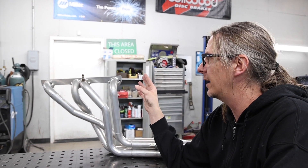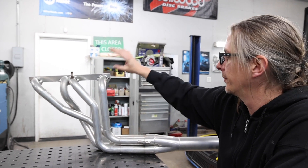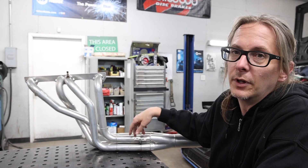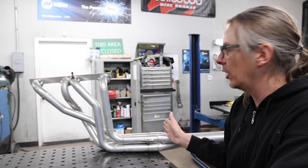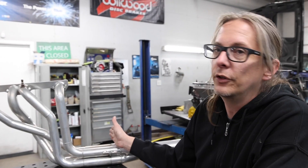So the big advantage of the header is, because you're going to make it out of individual tubes, you're going to be able to have a lot more flexibility in the size of the tube that you use. You're going to have flexibility in whether you have steps in it, where those steps are located, whether they're equal length or unequal length, and how long the primaries are. You're not going to have a cast manifold of primaries anywhere near this long. That primary tube length can be tuned for your specific engine. However, this is a lot harder to package. It's going to put heat on a lot more components in your engine compartment. You've got to consider that.